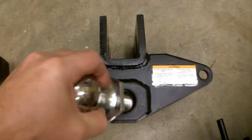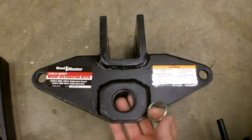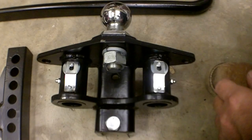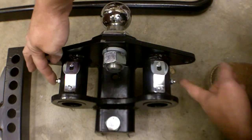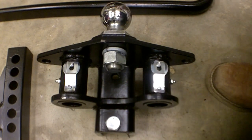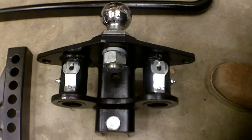I'm going to install my ball, but this hole is too big for the shank size here. I don't think they mentioned it in the manual, but it did come with a take-up bushing you can put in here. So I'll drive that in from the back side and then install my ball. I'm only going to be able to get it so tight here; I'll finish it off when I get it attached to the truck. Now there are some grease zerks on this piece. It needs to be greased monthly if you leave it all put together, maybe some fresh grease if you're starting to use it. I'm using the Lucas Red and Tacky No. 2 — this is my grease of choice for lubricating things like this.